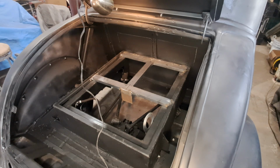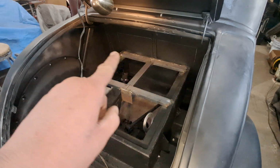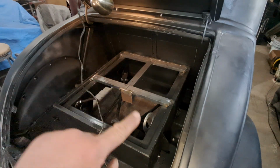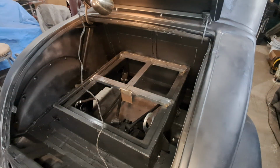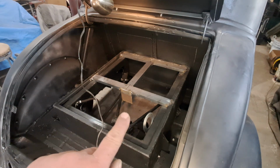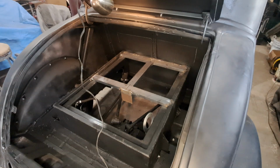On the next video, I'll be running a fuel line, and then we'll be tinning it. Then I got a 90-degree bracket I made for the back here, so when we tighten this thing down, across this way and down, it'll kind of push it on that too at the same time. And I got to cut a piece of rubber for it between the aluminum and the steel, otherwise it'll vibrate. So anything on that bracket I just put in, I'll put an angle in. I should have put angles in them right away, but yeah.